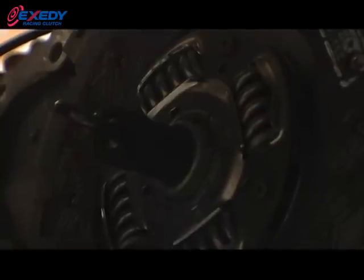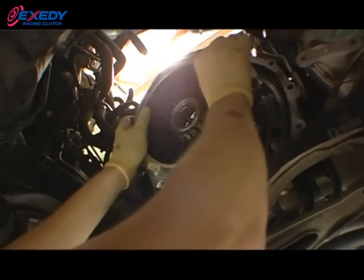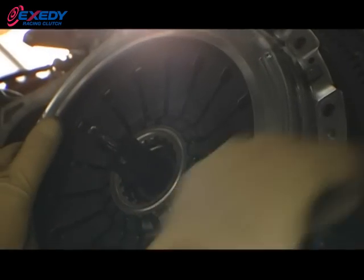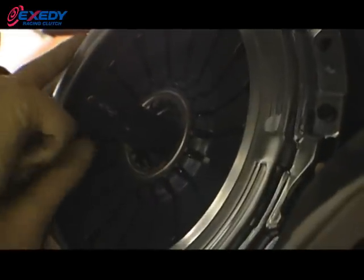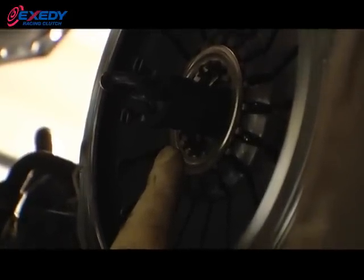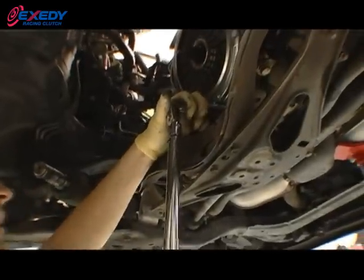Using your provided clutch alignment tool, place it in the middle of the clutch disc and mount to the flywheel. Place the clutch cover pressure plate assembly over the clutch disc, checking that the disc is the right way around and the hub section does not foul on the casting of the clutch cover assembly or the flywheel. Align the dowels on the clutch pressure plate to the flywheel. The alignment tool will ensure correct alignment, assist ease of installation, and avoid spline damage. Remember, red Loctite is your friend. Torque the pressure plate to 12 foot-pounds, ensuring not to use any air tools.